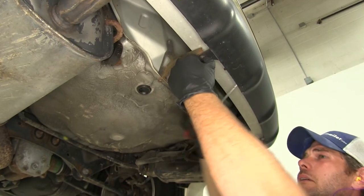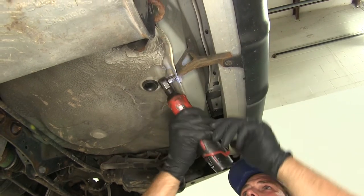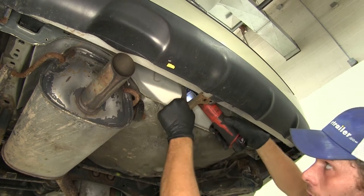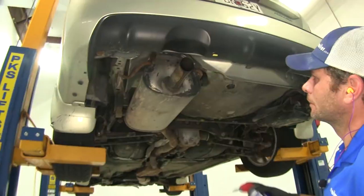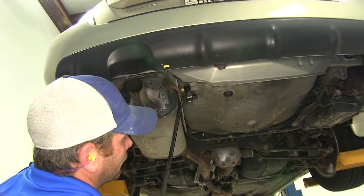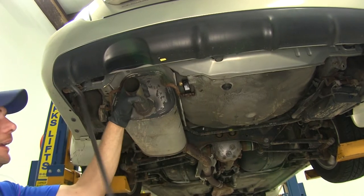We're also going to take down our fascia support bracket — remove the pushpin fastener. Then we'll grab a 10 millimeter socket and pull the nut off this forward attachment point and remove the bolt that goes into the back side of the trunk pan. We'll use a little spray lubricant on our exhaust hanger and get that separated — typically a large screwdriver or pry bar from underneath will get the job done. That gives us a little bit of room to pull it down and get in and install our hardware.